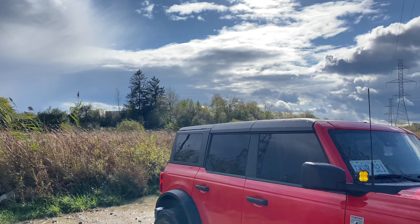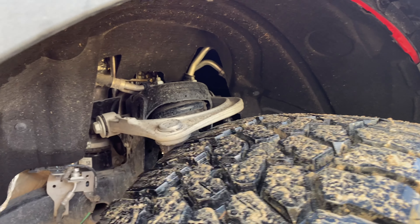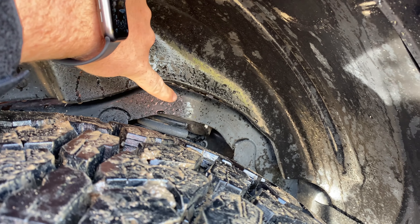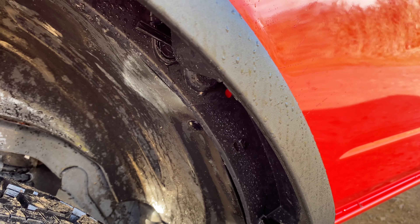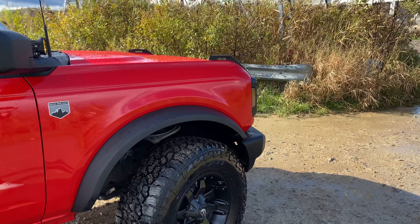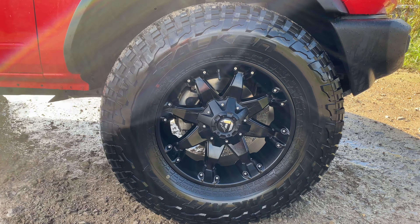Like I mentioned in my last video, I had a two-inch lift kit and 35-inch tires on order — those have finally come in and I've installed them. I have a two-inch Zone lift that was installed at the dealership. As you can see from the image from Zone's website, it's really just a puck that sits right on top of the coil. Super easy install; my tech said alignment was similar to doing a Ranger or an F-150. With the two-inch lift I decided to go with 35-inch tires.